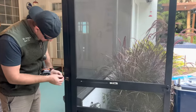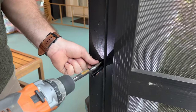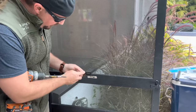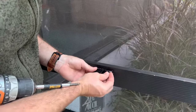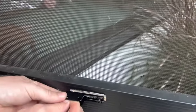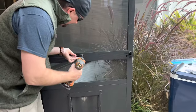Once you've gotten all the screws out, take the longer screws that were provided and fix the bracket in the same direction it was before, depending on how your jambs align. You can reuse the existing holes. On the piece that goes on the door itself, put the open end facing out, then find your old holes and hopefully reuse them — though you could also drill new holes if needed. The back one is fixed and one kind of slides, so do the back one first.